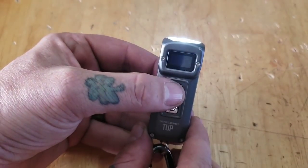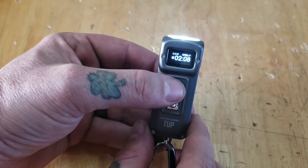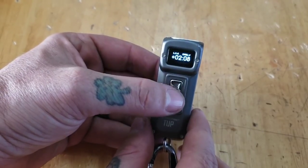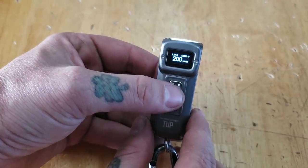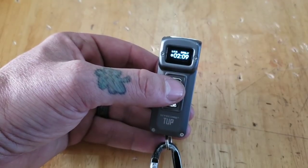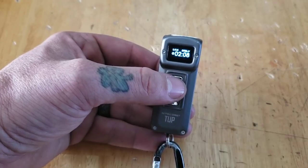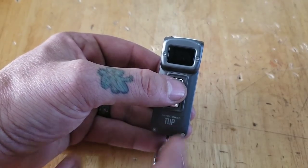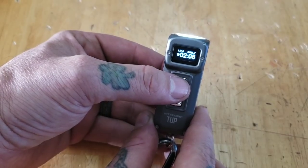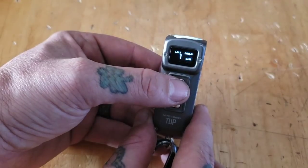These are approximate run times, and the instruction manual openly says they are estimated. I found them to be completely inaccurate — that's one of the downfalls here. I left it on 200 lumens, started a timer, and it didn't even get close. After five minutes it said it was off, yet it ended up running for almost 30 minutes before I turned it off myself — even after it said it only had nine minutes left. So these are inaccurate run times. It gives you a general idea of how long you have left on certain levels, but don't rely on them precisely.